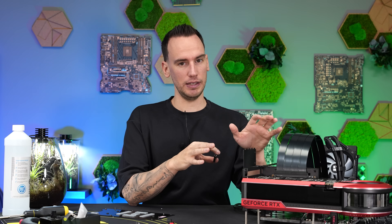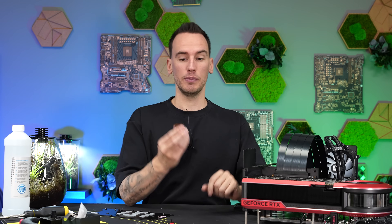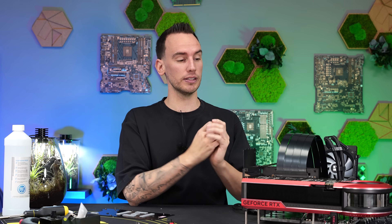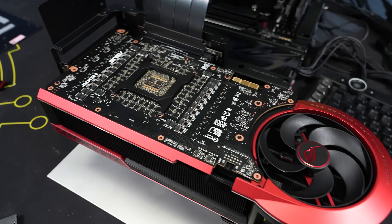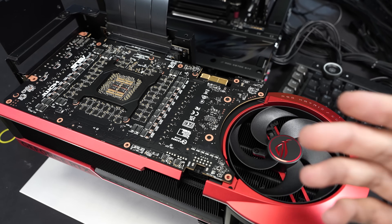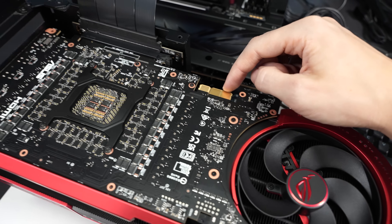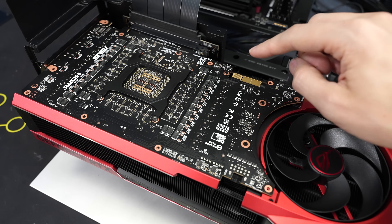Now I'm trying to mod the 5090 Matrix to be usable with 800 watts through the 12V high power connector, without doing a shunt mod or any modification on the card itself — using the BTF adapter as a modding bridge. The goal is that you can use the Matrix on a riser cable vertically or horizontally, on a non-ASUS, non-BTF motherboard. We'll use a test stand hooked up through a riser cable so I can access the BTF connector while the card is running — that's also why I removed the backplate. My theory is the card can run through the BTF connector without the 12V high power connector, implying all its functions are present on the BTF side as well, so we should be able to fool the graphics card.